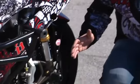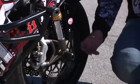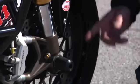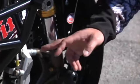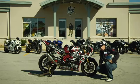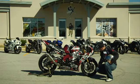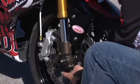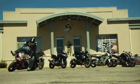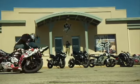This bike actually has a custom front end on it as well. It's got oversized rotors off of an '07 ZX10, as well as the wheel conversion for the ZX10. You'll see these custom-built spacers right here — any local machine shop can make those for you. It's not something you can just buy anywhere. Custom parts on a custom stunt bike, but this bike sees full-time freestyle duty traveling all across the US. I also run a fork slider in here from sickinnovations.com — the people that make the crash cages — once again keeping the bike from hitting the ground.